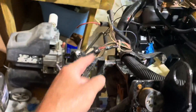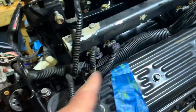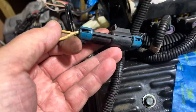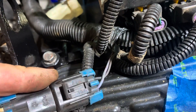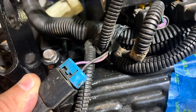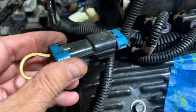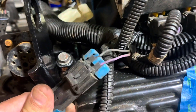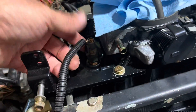There's a bundle of wires right here that went in two directions. This bundle came over this way — you've got two injector connectors here. There's also a loop-back wire; based on the color I'm not real sure what that is yet, but purple and gray are usually for ignition. I'll look at the diagram and figure it out later. You also have two injector connectors here, and an intake air temperature sensor connector there.